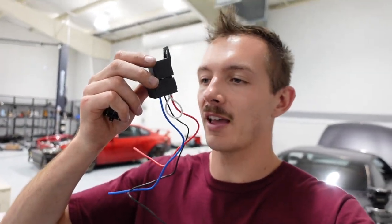One thing with S-chassis — you probably know this — if you're ever tuning, you will usually have voltage drop issues throughout the chassis wiring. The fuel pump might only see like 11 volts, which translates to a huge difference in the volume of flow. So typically I was going to walk you guys through popping a little relay in, taking power from the battery, and having the factory fuel pump wiring trigger it.